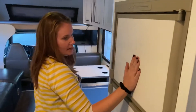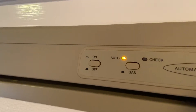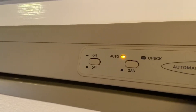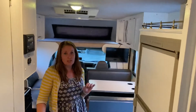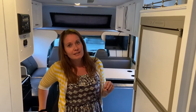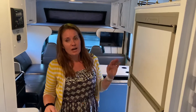You have a nice size freezer and a good size refrigerator. You want this auto light on, and that means your refrigerator is going to be working whatever kind of power you're using — whether you're driving, it's going to use propane or whatever. You never have to touch it; it's just going to stay cold for you as long as you have some battery going. Now, one thing I want to point out about the generator: if you are dry camping — meaning you're not plugged in at a campsite — you want to make sure that you're running your generator for a good hour to two every morning and a good hour to two every evening. That's going to keep your batteries nice and charged so you always have light and power to your fridge.